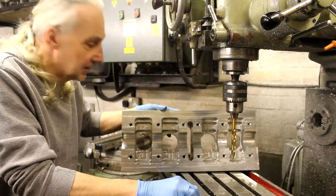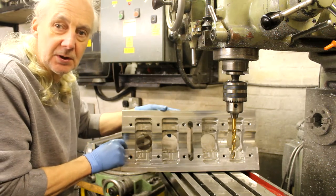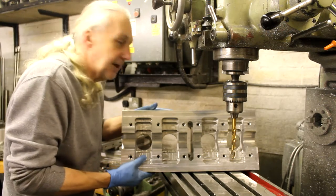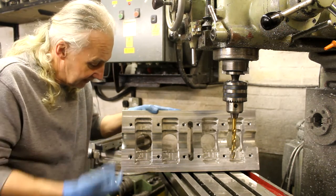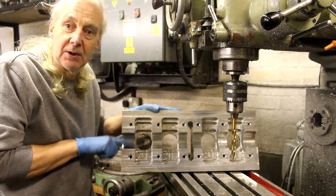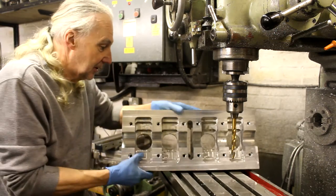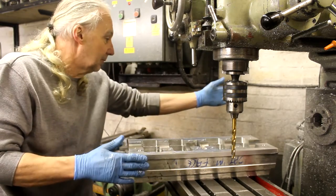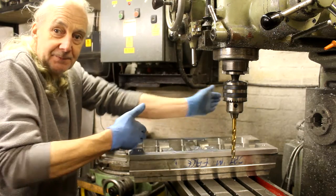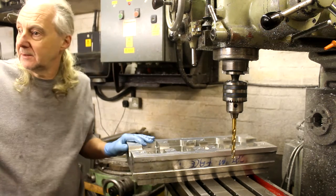So what is this going to be - a roller bearing crank or a plain bearing crank? Plain bearing, but with two roller bearings at each end. I've checked because of side loads - now the power is there, you put roller bearings in because you've got a belt drive, and as soon as it pulls it puts that much pressure on the roller bearings. Same at the other end with the supercharger drive - it doesn't like it. What happens is, because the blower's there and the drive's there, the crank is trying to flex.